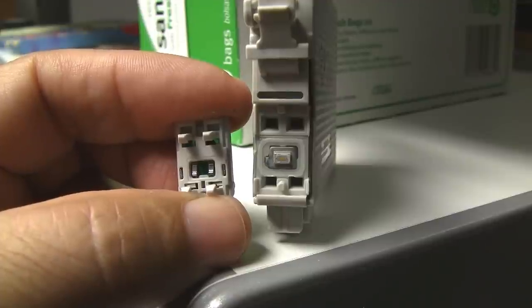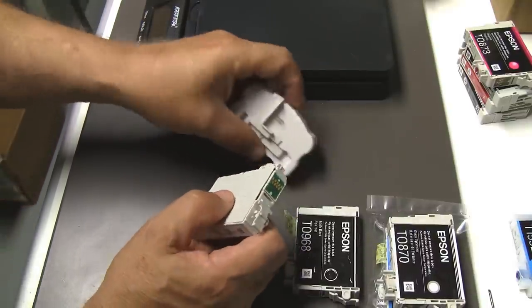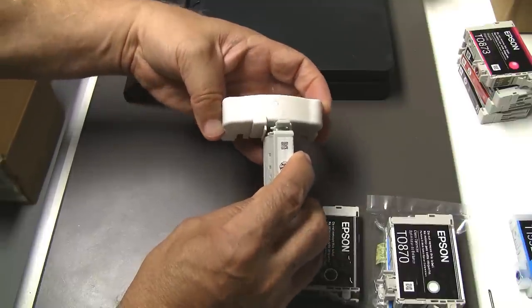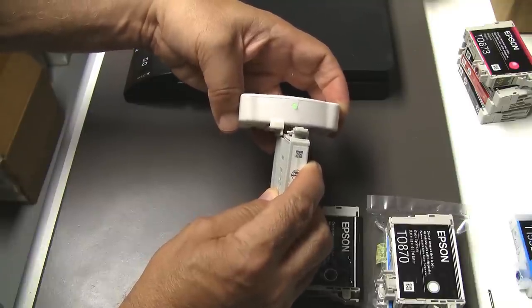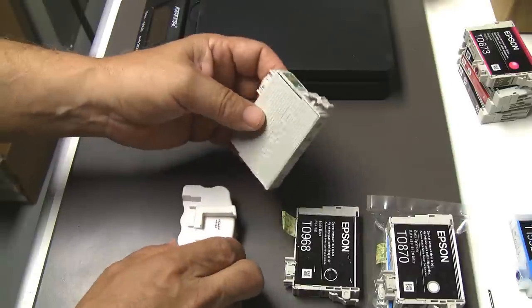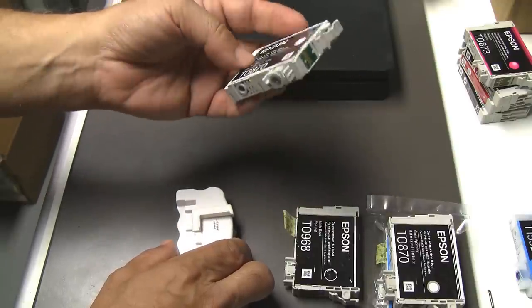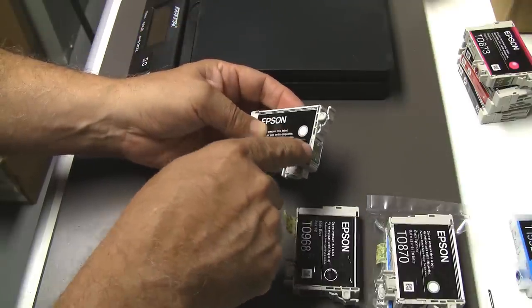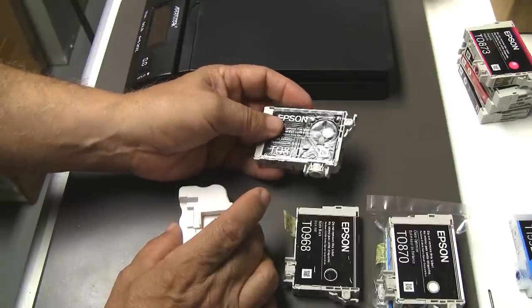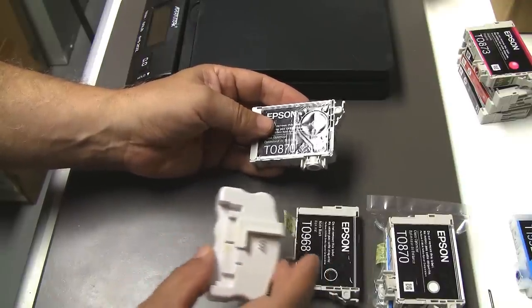Let's go ahead and pop this back in and proceed to reset this chip. As you can see, I have popped the chip back in position and I'm going to reset it. You hold it like so, and the light turns green — so now the chip is reset. I have no idea how empty this cart was, so whether I'm able to refill it or not it may not accept it. The trick with a cart that has a wetness sensor or air sensor is to never allow it to get below 20%, but I have been able to reset when it was down to about 10%. You visualize it on your ink monitor — it's splitting hairs at that point.